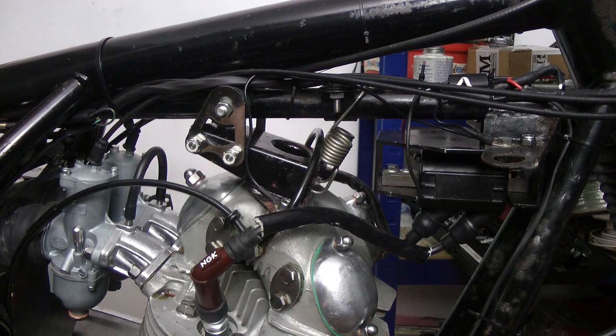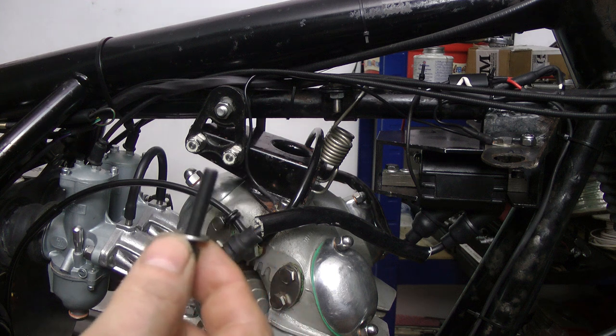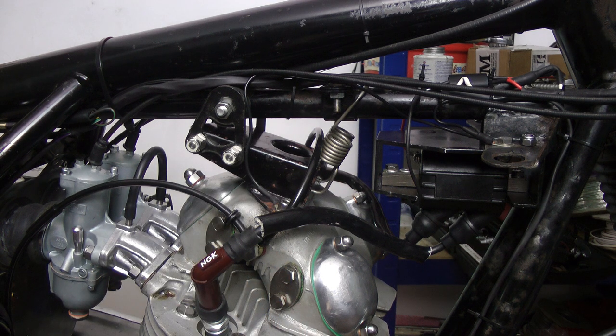Specifically for the Trispark ignition, having taken all of the old ignition parts out, you then need to actually work through their list. One of the first things they suggest is to ensure that the Allen screw that you use to mount the rotor doesn't bottom out. Now they supply 2 Allen screws. They provide a 26 thread per inch BSF Allen screw and a 24 threads per inch UNF Allen screw.